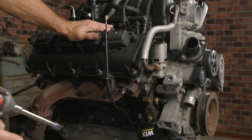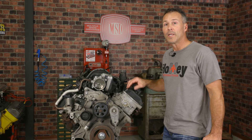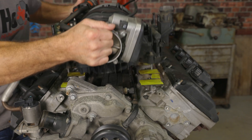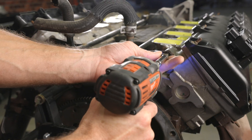If you plan to remove your oil pan completely, you'll have to remove the dipstick tube. To make removal of the heater tubes easier, on some vehicles it may be necessary to remove the intake manifold. This helps provide access to all the bolts and room to remove the heater tubes completely.